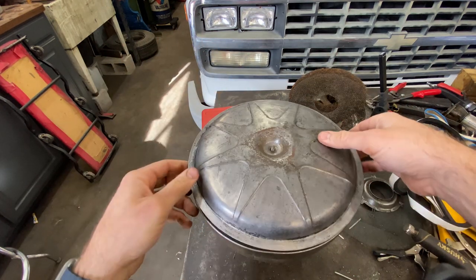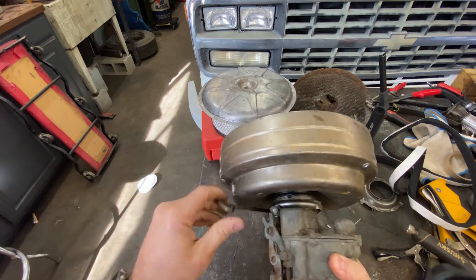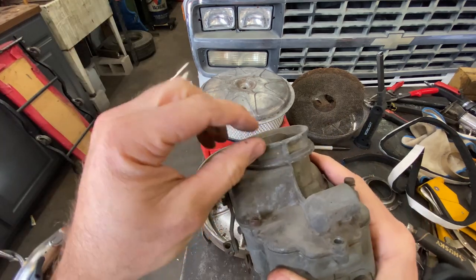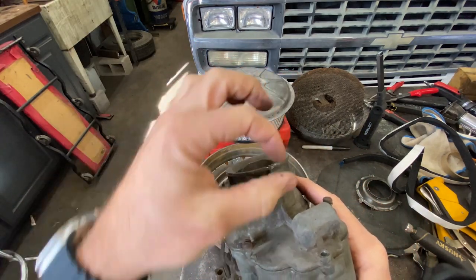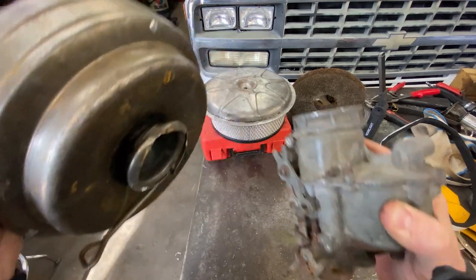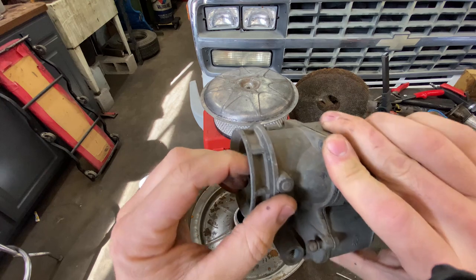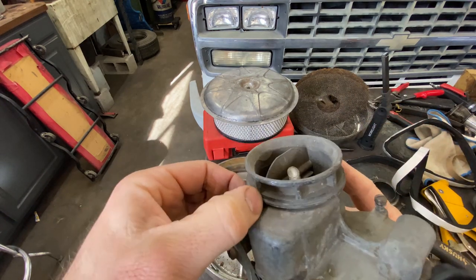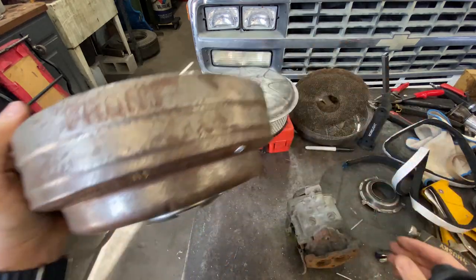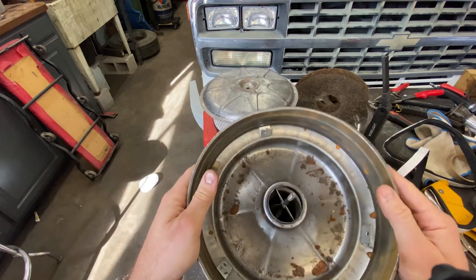The carburetor presented a little bit of an issue because I had to change it. This style of carb has what we'll call a castle collar — it has all these different bumps. The original one had a raised donut-shaped portion that the clamp actually clamped onto, so this clamp on the original one was not designed for this style carburetor. What I did is — we have a lip here on the underside, but the pivot point for the butterfly gets in the way. All I did was marked it and notched it so that it went over those two pivot points, and it actually clamps down, gets up underneath that lip, and holds it really well.